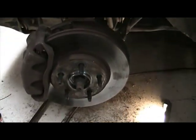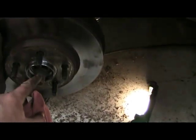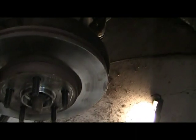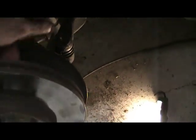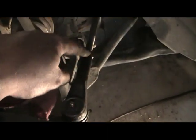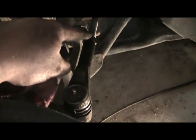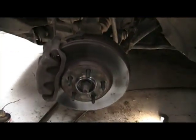Now there's our completed unit. I went ahead and slapped it together. This is torqued, and you've got your bolts back here that holds your brake unit on. This is out of the way, this is lubricated, so that's good. This one here is not exactly on until we get it to the alignment shop — 19 turns on the inside here is what we look at. So we'll get that; that's snugged down good. That's all completed up inside there, so we're actually ready to go back together with this one.